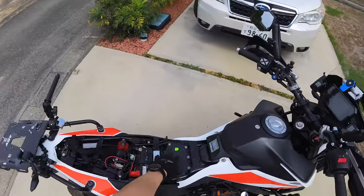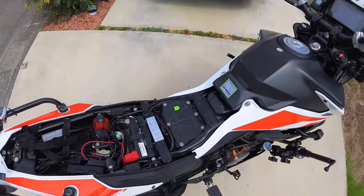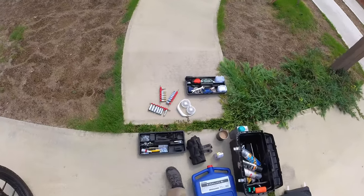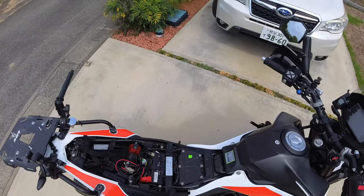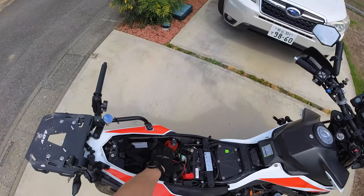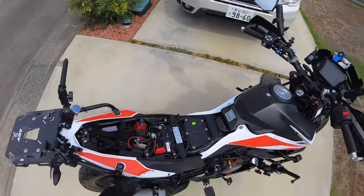One of the things I did is I removed the lid filter that I had on here. I don't want that engine honk on me — I'll be driving about 1,200, 1,300 miles, and I'm just not wanting to deal with that massive engine honk. So I ended up replacing that with the stock lid. Essentially right now the filtration system I'm using is the snorkel with a pre-filter on it, and then I've got the stock filter inside there. That should be good to go for what I'm doing.